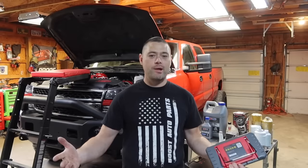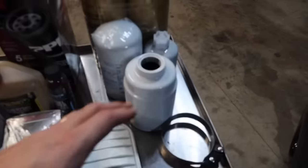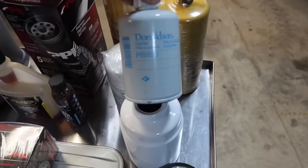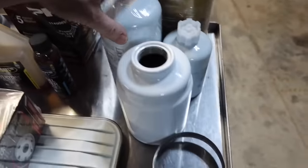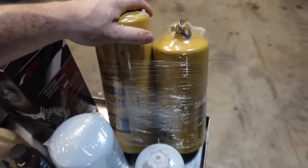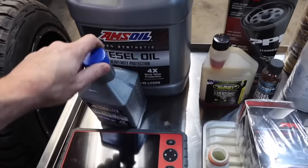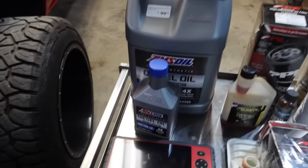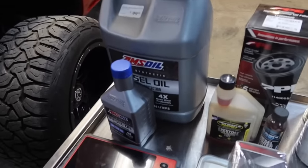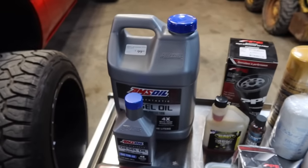These are very expensive vehicles to own, so definitely like to keep it simple. Something like an AC Delco fuel filter will be perfect for you guys. In my case I do have a lift pump. Lift pumps are always a great option, and it's something I highly recommend, especially Air Dog. Here's the fuel filter itself, and of course you have your CAT filters — this is from Mark DeCola Diesel Performance. Today I'm going to be using Amsoil 15W-40, which is synthetic. You don't have to go this expensive route. You can also use Rotella 15W-40, Royal Purple — all kinds of stuff on the market. I personally like the Amsoil and this is what I've been running in the truck. When doing an oil change you want to use 10 quarts of 15W-40, as well as an oil filter.